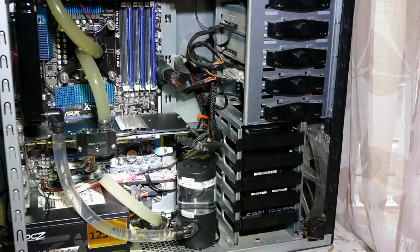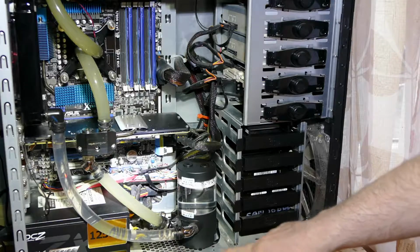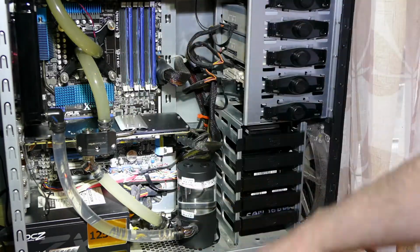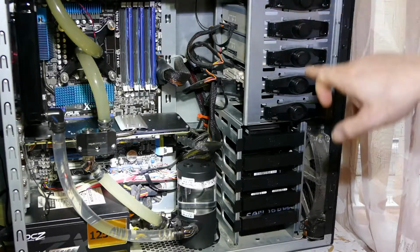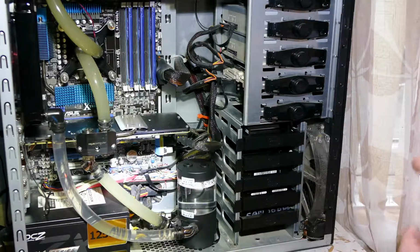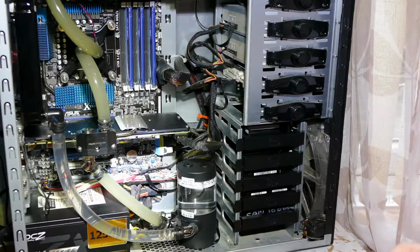What I said about the head, it's a closed loop system. So the head is basically, it pumps it up, so this is about 0.6 of a metre. So it pumps it up, but also gravity pulls it back. So the head is not as important in a closed loop system. What goes up is coming back down basically through gravity, so the pump is not fighting as hard.